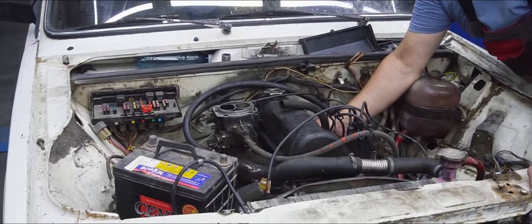Now let's see how the head is faring. I do see marks — they appear to be from the ceramic. Let me just brush this off. Look at how it cut up the aluminum — it's covered in craters. This took a merciless beating. The ceramic debris is hard, and before it completely crumbled, it did some serious damage. Take a look at that — this is some doom and gloom. This sort of damage requires resurfacing the entire cylinder head.